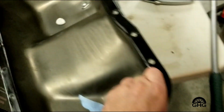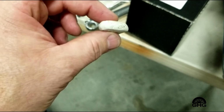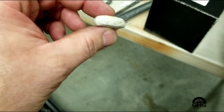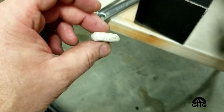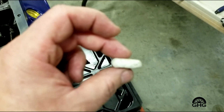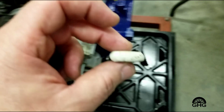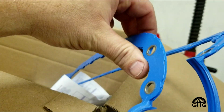In this case, it stayed on the oil pan, but you can see that is roughly 3/8 of an inch. Now you throw the oil pan gasket in, so you're going to be in between that measurement. I said 3/8 and 1/2 inch. That might be a little closer to a quarter, but by the time you put the gasket on, which is a little thicker, and this particular one is a Felpro unit, and it's got the metal stops on it. You can see the little inserts. So yeah, that's the engine.